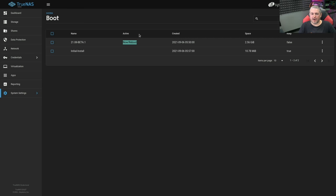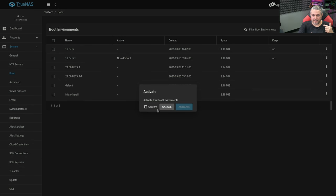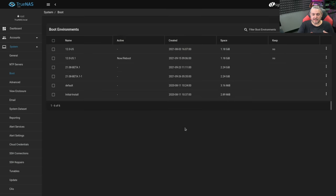I'm not sure if I'll try a fresh install to see if that causes any of the performance problems. But back on the TrueNAS Core system, once you roll it back, it doesn't want to roll forward — you'll get an error: 'TrueNAS Scale cannot be activated. TrueNAS Scale needs to run the update process again.' So you just go in and run that process again, which is pretty straightforward, and it'll migrate all the settings.